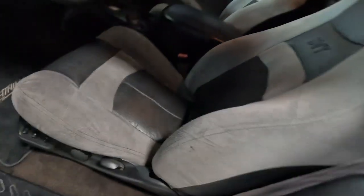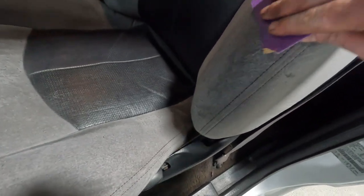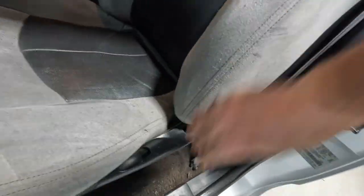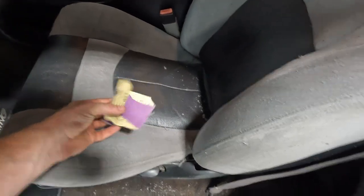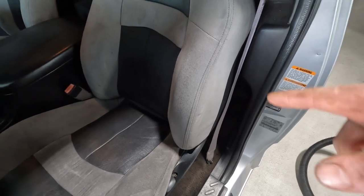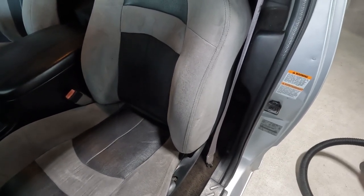If you were skeptical in my last video when I was talking about taking sandpaper to your suede — check this out. You guys are wondering what grit I used? 150. I'm going to grab the vacuum real quick and then you'll see the results for yourself. A little bit of foam sanding — or suede sanding — of your seat can go a long way. A cool little tip for y'all today.